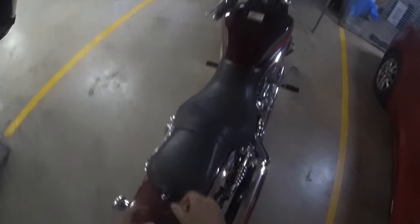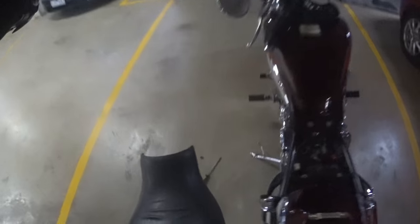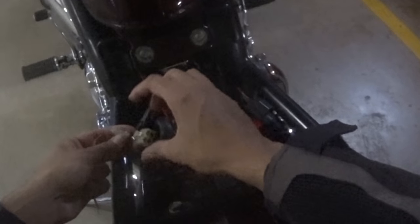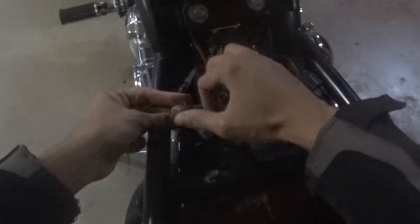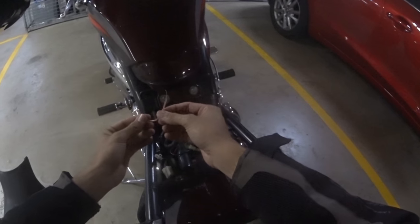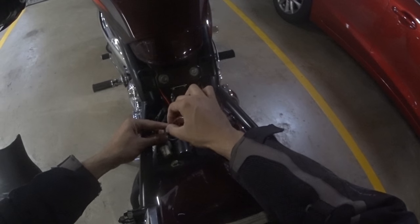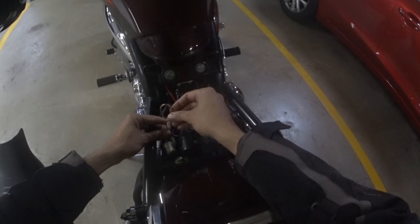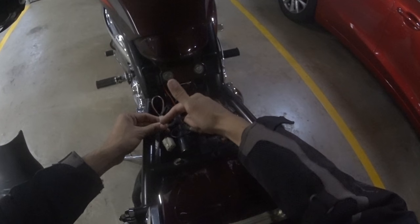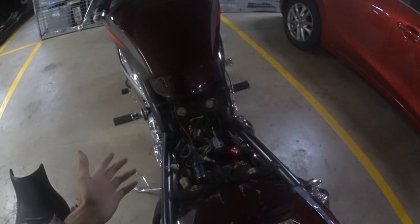To access your port you'll need to take off your seat. Under your seat you've got all of these wires. The fault code wire that you want is not the one with four plugs, but the one with two. This one's got a black and white wire and a black wire. You'll need a piece of wire or a paper clip — just something to bridge these two pins together. If you have a piece of wire it's as easy as plugging it in like this, and it bridges the circuit together and will make the fault display on the bike.